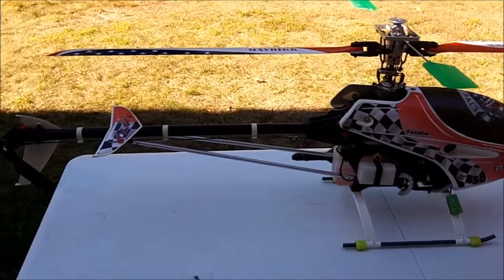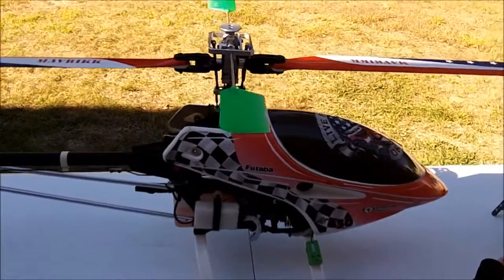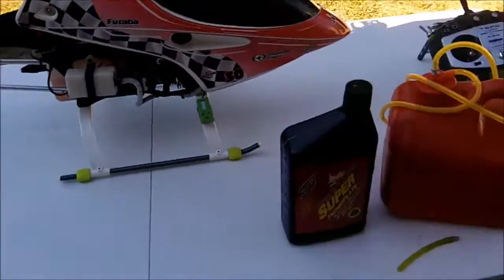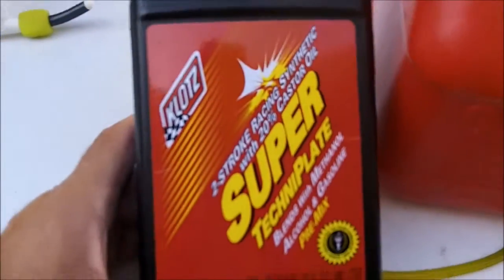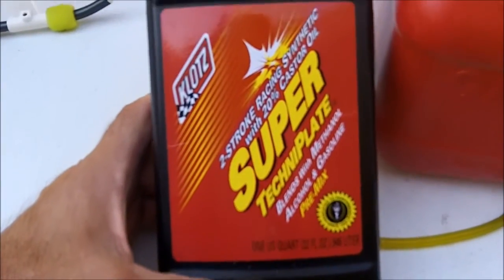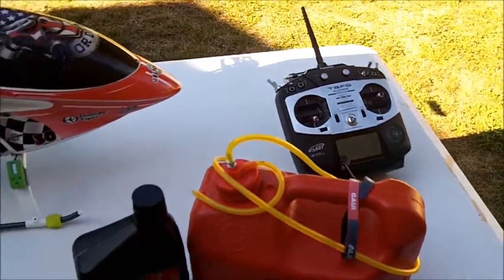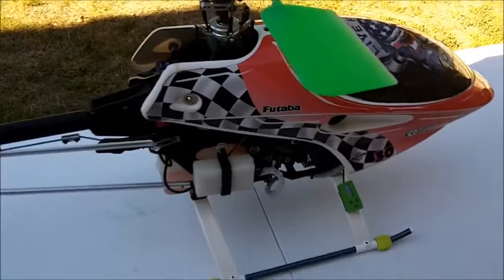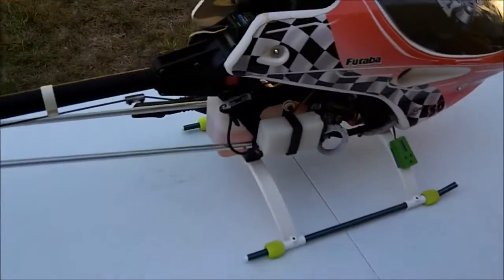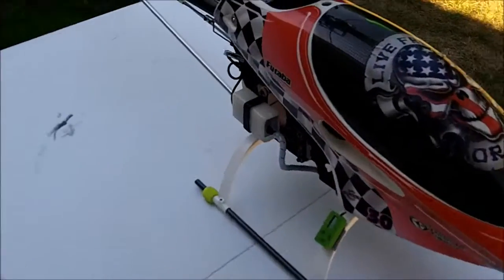This is CruiseRoy with the Raptor 30 — it's the Version 2, and I want to do an overview of it. I've converted it to a gasoline engine — that's right, it runs on gas. I have a little adapter tube that fits into a DuBro quick-fill port and I'm running Klotz Super at 10 to 1. I'm using my Futaba T8FG radio, Maverick blades, and neon paddles so I can see it flying. It's also got a G-Force head on it. Otherwise it looks like your average nitro machine, but it's running on a gasoline GO engine.